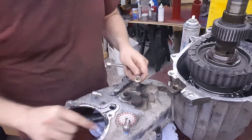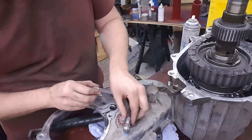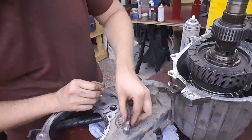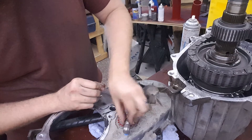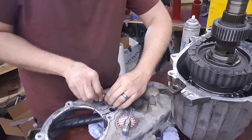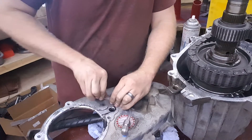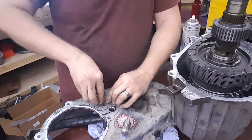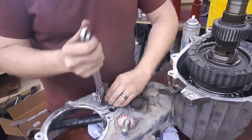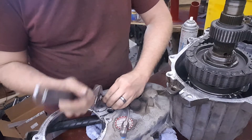Now that I've got both of my elbows in, they're taped and sealed, and I cut my hose to length — all I gotta do is tighten her up. This is going to allow me to see what's going on inside the transfer case, at least for the fluid level and even the fluid color, while I'm out wheeling or just driving around in town and sense something going wrong. These are compression fittings for the 3/8 hose.